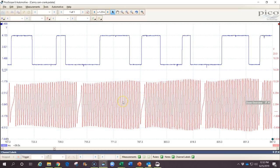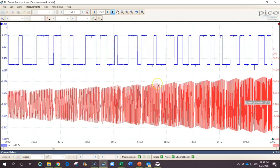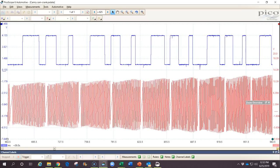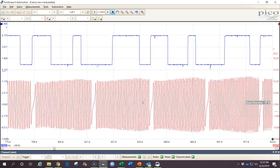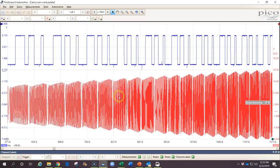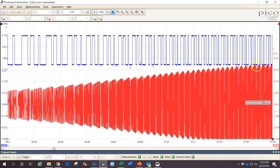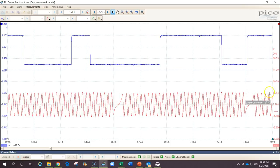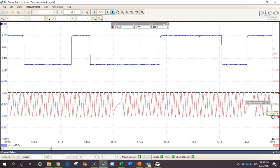That's how we get position and speed from our sensors. As far as we can see, both sensors have a consistent repeating pattern. As engine RPM increases, the frequency of pulses increases — that's expected. On the analog signal, the amplitude also increases with RPM. We need to make sure that at idle, when the engine isn't spinning fast, we have sufficient amplitude covering enough voltage range for the ECU to detect it. In this case it's covering about an eight-volt range, from about negative 1.5 volts up to positive 6.5 volts.